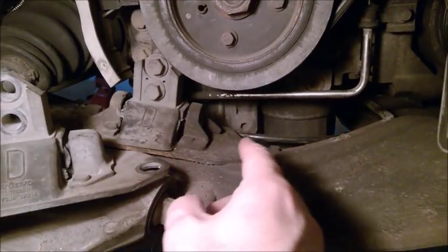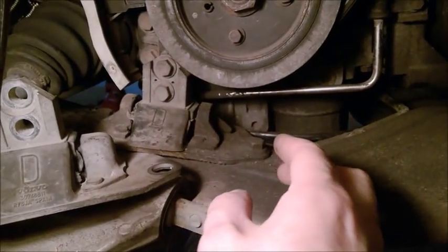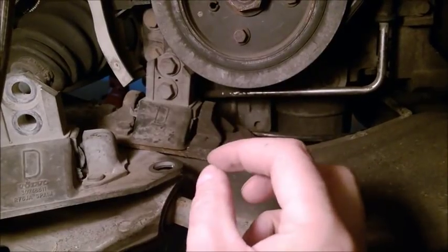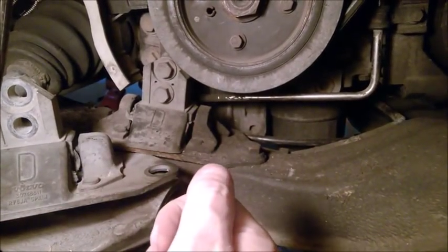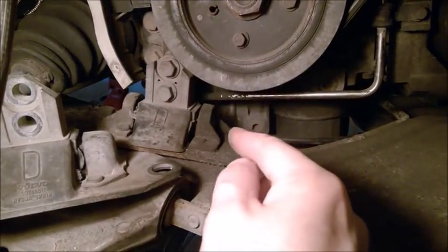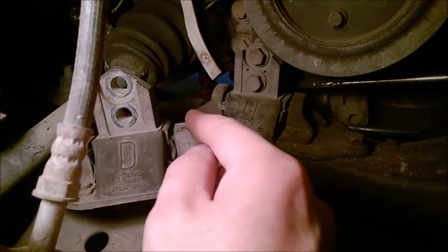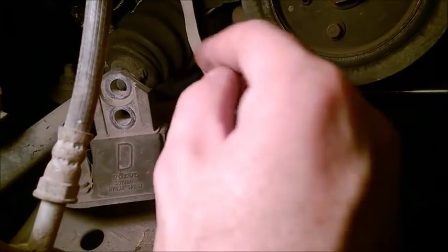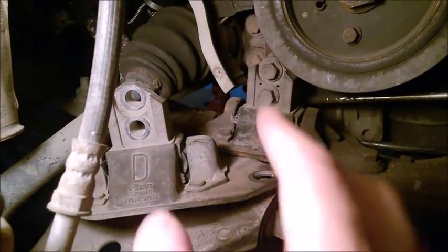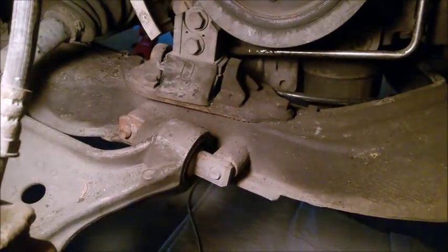And also that will save the power steering line. And talking about the power steering line, I've read of two people who had it crushed just at this area, just kinked, just like a dent in it, but it started to spill power steering fluid. And you don't want to start replacing it, because it's attached to the steering rack, and you have to lower the subframe. It's very, very unpleasant to work on the steering rack on that side to replace that line. So warning about this, prevent the engine from shifting to the side.